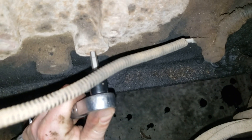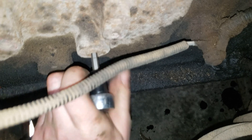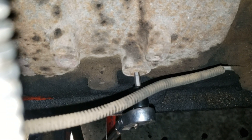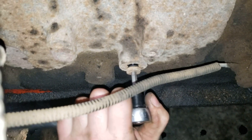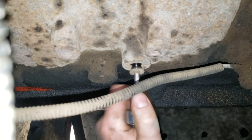We're gonna go ahead and jump right into this. First thing you want to do is locate this little plug here that's down by the fuel filter on the driver's side of the truck on the engine. Crack it loose — it's a six millimeter Allen socket — get that thing pulled out of there.